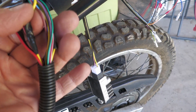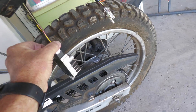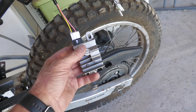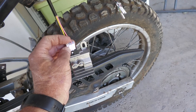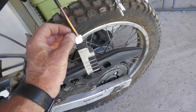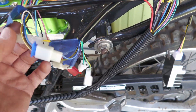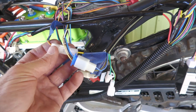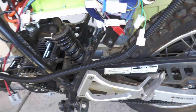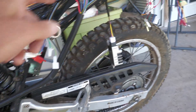That yellow wire splits in two spots. One of the two goes down through the harness to your 72-to-12-volt power step-down, and the pink wire out of that feeds all your 12-volt stuff. The other yellow wire goes back to the ignition — it plugs into the orange one off the controller, and that's what tells your controller to turn on. So the red power goes to the switch, switch converts it to yellow, and that yellow goes to two places: one to the step-down for 12-volt, and one to the controller ignition.